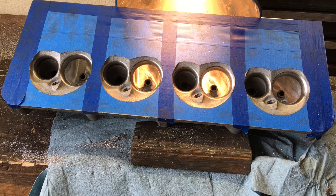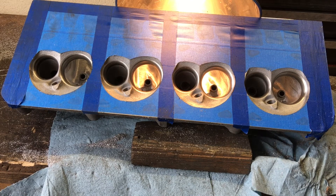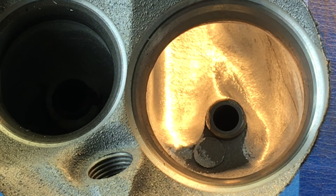Using my landmarks, I started working the ports, blending in where the swirl ramp removal was to the back wall without digging too deep, and smoothed the short side of the port around the guide. To maintain consistency and repeatability when doing this port work, do one procedure — whatever procedure you're working on — do it to every port on both heads before you move to another procedure. I'll even go as far as, even if I want to do more work in a certain area but it requires a tool change, I won't do it until all ports on both heads are at that level of work.